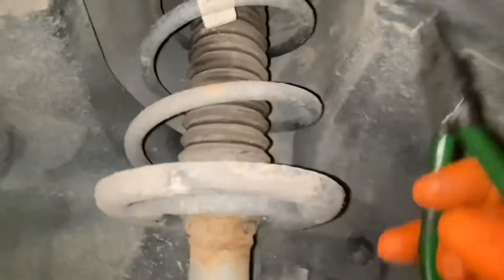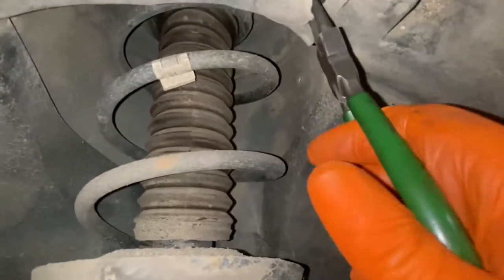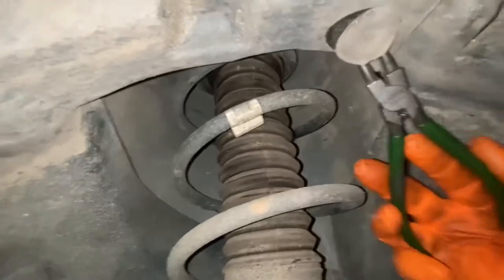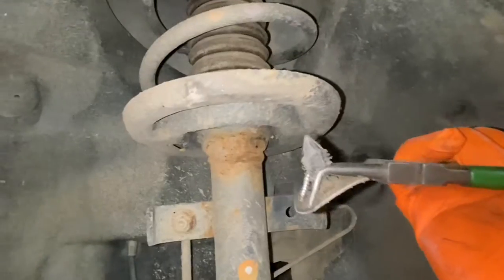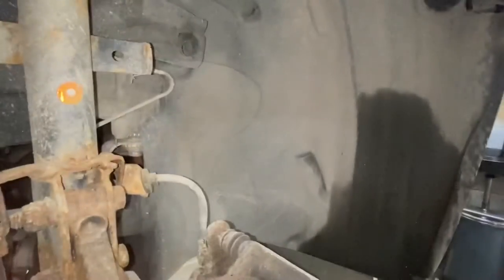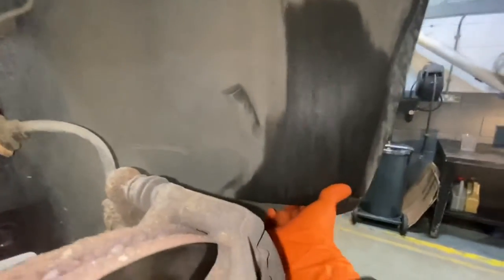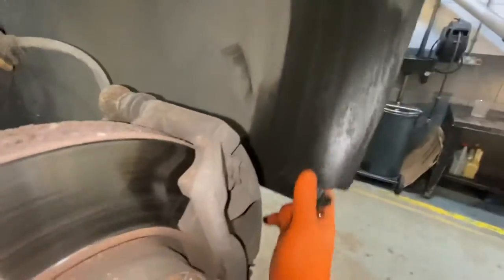Literally you just got to get something underneath them, to pop them up. So as you can see, I just get a flat clip tool like this. So literally just go underneath it like so, grab hold of the middle of it and pull forward. Like so. And it just comes straight out. You just do that to all of them. And once they're all out, you literally just take this cover out. Remember to remove that screw down there. Let's just pull it out.